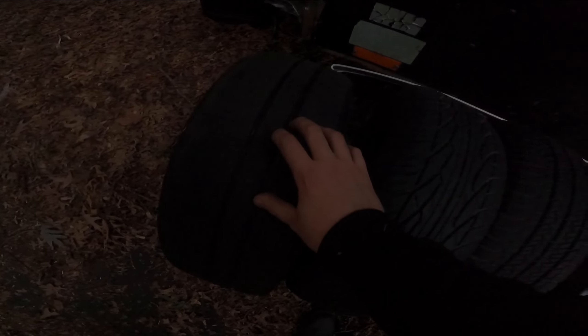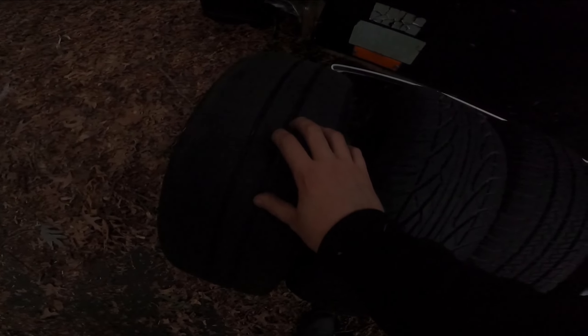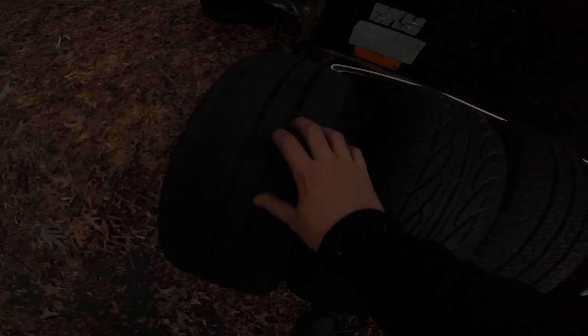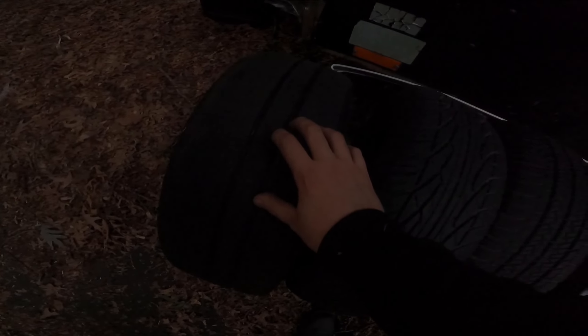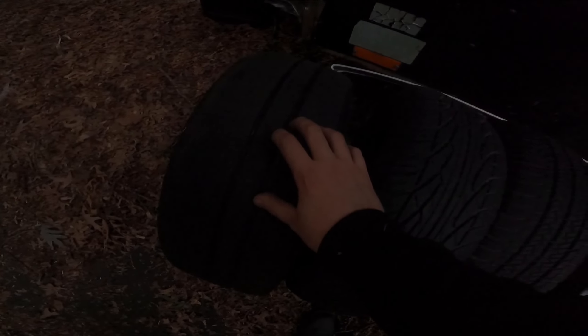Now we're going to talk about something a little different. Here's another snow tire I have right here. Most people think that tires get old and need to be replaced once the tread is worn out. But there's actually another thing that can cause tires to need to be replaced, and that is a tire's expiration date. Yes — believe it or not, tires do expire. As rubber ages, it gets old, brittle, and begins to crack. It dries out and gets hard. As you can kind of see right there, all those lines — this tire is dry rotting, beginning to crack, with the rubber pulling apart inside the grooves and on the edge of the tire. That is very bad for structural integrity. The rubber on these things feels like I'm trying to squish a rock. These tires are well past their expiration date and would not be safe to drive on.